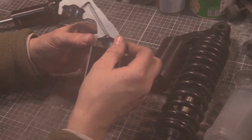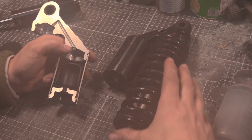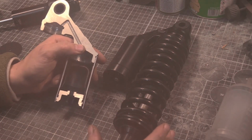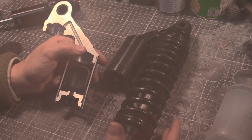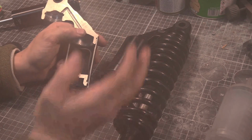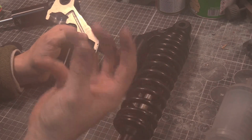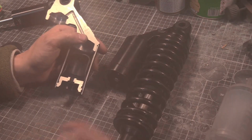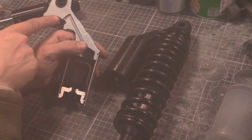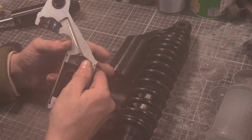We know what happens when you go to squish the suspension. You are acting against the spring, right? You are trying to compress this spring. And to control the rate at which that spring compresses, we use damping, right? And it also works the other way. When the spring pushes back out, instead of going through this whole oscillation, the energy that would make, just say, a weight, a mass on a spring bounce around and keep on oscillating backwards and forwards, right? That energy is used to move this fluid around, right? To squish it through this passage and down into here and all the rest of it, and then into this region. So, what is the whole point in all of this?